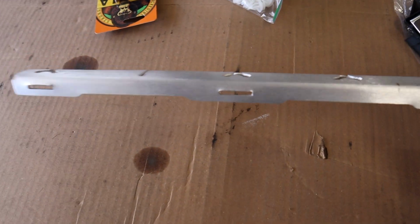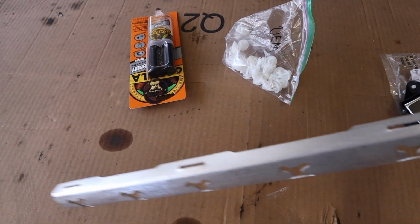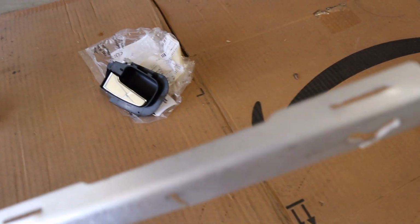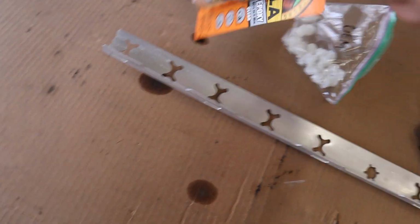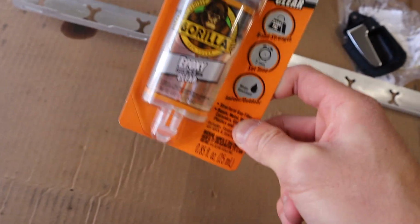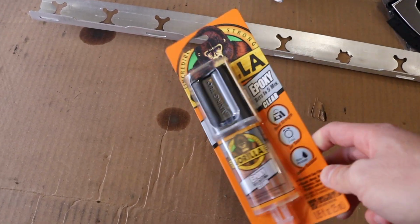Anyway, after that's installed, I have this upper door panel mounting piece. Most of you guys probably know there's that upper piece that mounts onto the door frame itself on the door panel, and those are made of plastic, and after 20 years those things break like hell. So this is a solution that someone made on eBay, which I'll link below. I'm pretty sure they want you to mount this into the door frame first and then glue it onto the door. And for that, I bought this stuff. Apparently it works pretty well, so I'm gonna test the method of putting this on the door frame itself, putting the glue on the door panel, and then setting it that way.